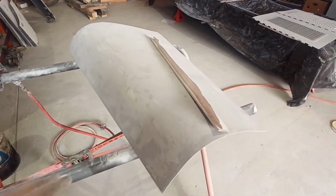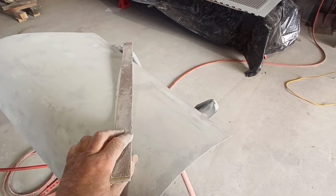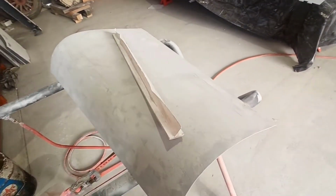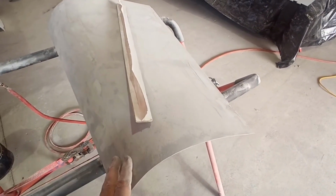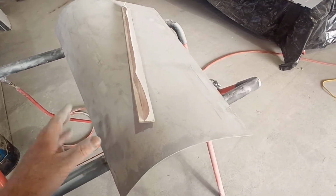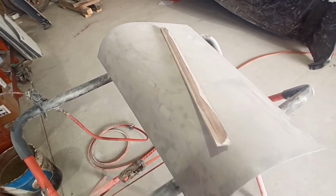Alrighty, so at the moment, this is the second one. I haven't touched that first one with the extra bit of glazing putty in it. What I'm actually doing, I've got a partly worn bit of 80 grit that I'd been using on everything else. So it's not real sharp, but it's sharp enough, if you know what I mean. Just to try and pull this down a little bit quicker first, especially because I knocked the surface off it to start off and then put some glazing putty in where the worst of the marks were. I've missed a few, but we'll get them again. I'm just trying to rip this down a little bit quicker, and then I'll jump back to the 240 and keep blocking.